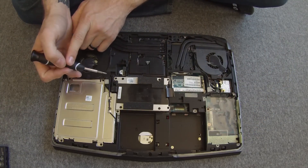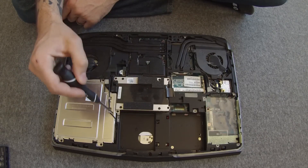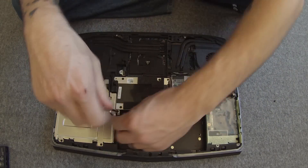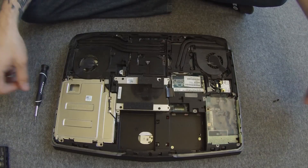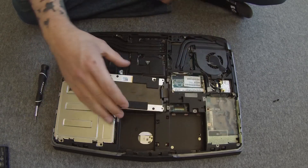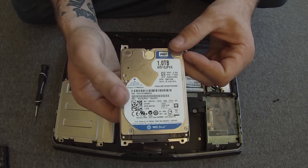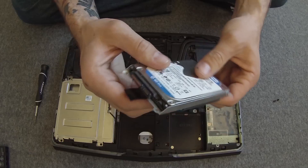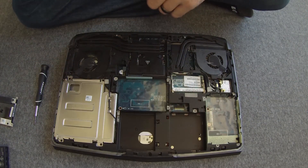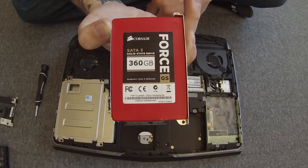Now we'll take out the HDD1 hard drive bay. There are eight screws on top: four screws hold the hard drive in the cage, and the four outer screws hold the drive assembly into the computer. After removing all the screws, pull up on the back a tiny bit and pull backwards to separate the connector. The hard drive I have in here is a Western Digital one-terabyte Blue edition — this is my storage media drive for video editing footage, downloads, and everything like that.